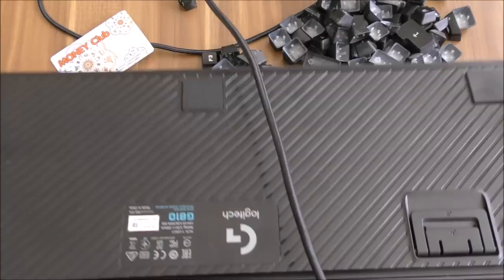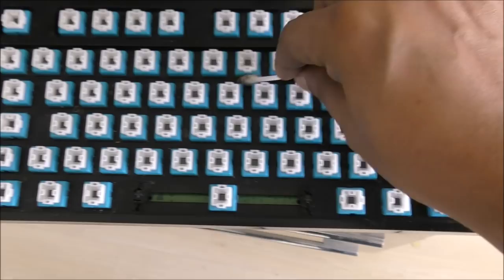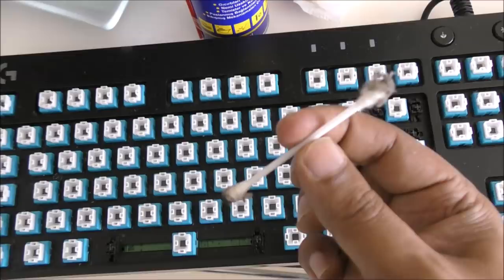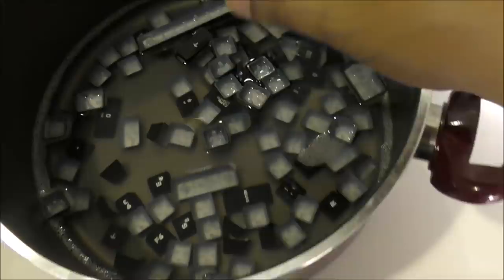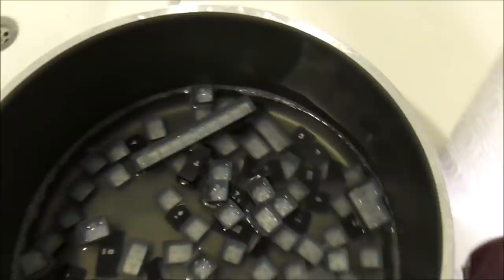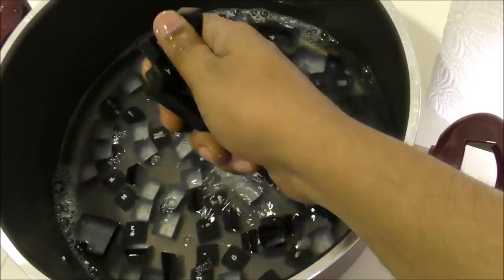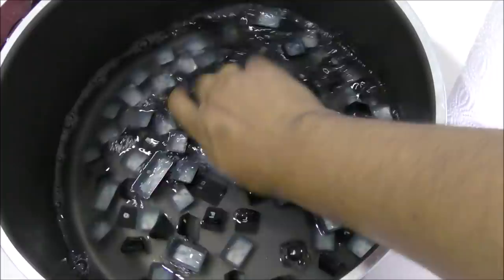All done — I can clean the keyboard now. Here I use a cotton bud and clean the board — you can see so much dust. I just put it in the corner and move it all the way; it's very easy to clean that area. Put some thinner or alcohol on your cotton bud and all the dust will come away cleanly. I put all the keys in a small basin with a little bit of detergent and leave them in warm water for a while, then clean all the keys — the dirt will be removed automatically.